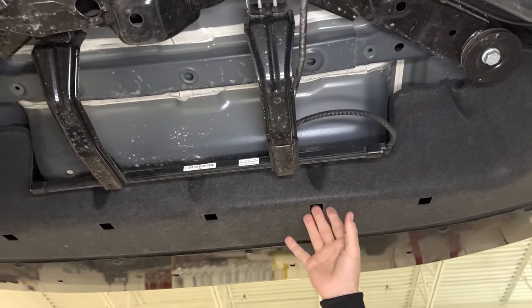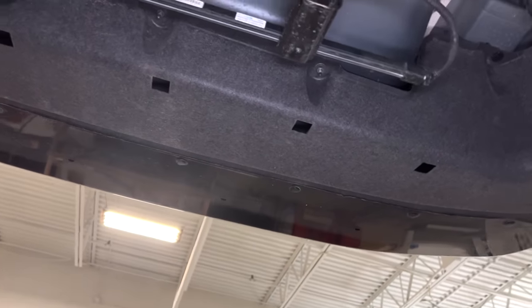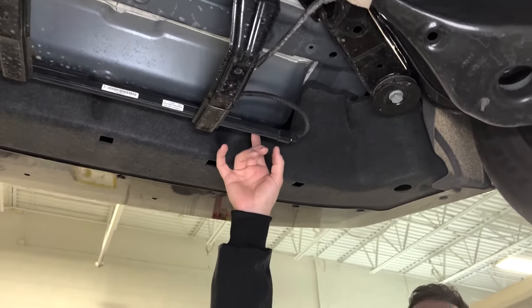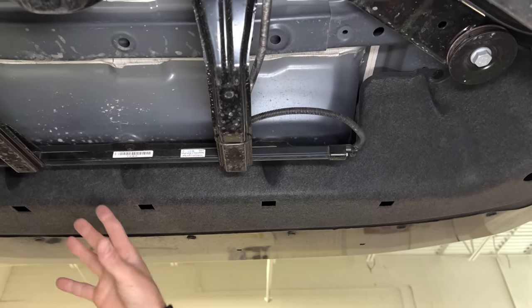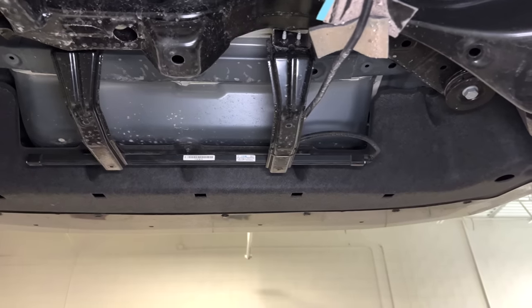But right next to it, less than 100 millimeters away, we have another shield. If we were to change the material of that shield, go to injection molded, for example, it's very possible that we could just snap these lights in or mold a portion of the housing for this light in, versus having separate stamping, separate fasteners, separate processing, separate assembly. Those are the things that we're really trying to look at.